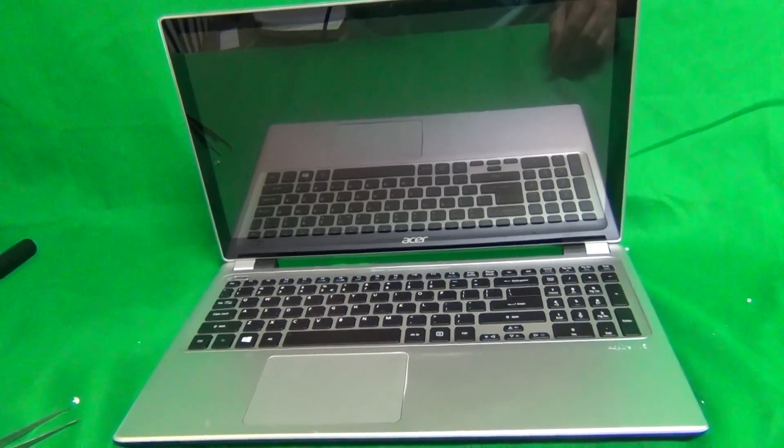We reconnected everything. Next, holding the webcam with your fingers, put the screen assembly back in and snap it to all the places again. Now we have a laptop with a repaired screen assembly. Go around a couple of times to make sure it's properly snapped in, then put the battery in and you can test the laptop. Once again, my name is Eugene Panritkiewicz. I'm the Laptop Screen Doc and the name of the website is www.ScreenSurgeons.com. Thank you very much and good luck.